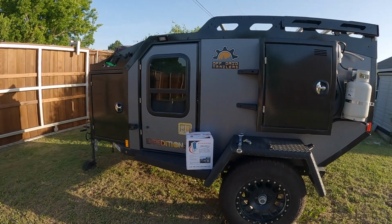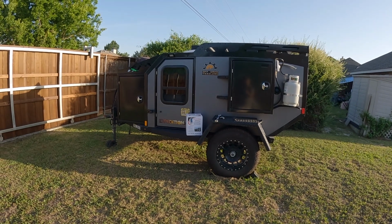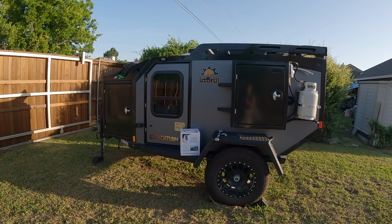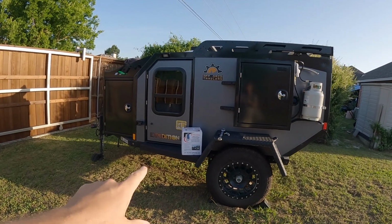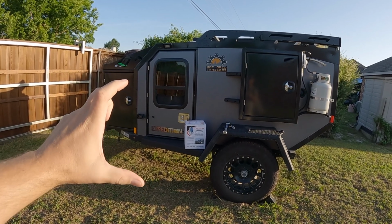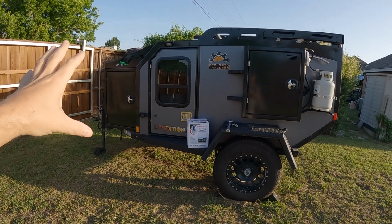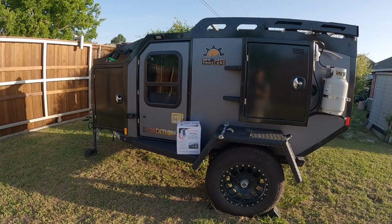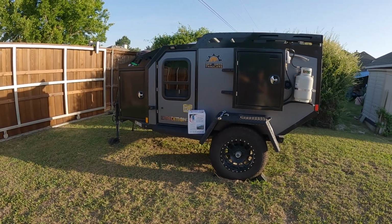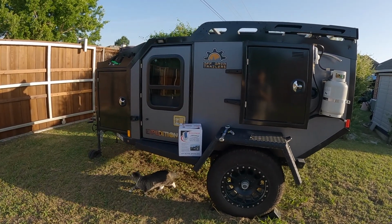Now, as far as installing these things, just to let you guys know, if you've got a custom shop that's willing to do it, awesome. I reached out to a couple of custom shops here in my area, and neither one of them wanted to commit to it. And the reason for that is to install these, specifically on a 4Runner, you have to cut about 4 inches off of the spring bumper that's inside the coil. And it's just a rubber bumper, but it is a permanent adjustment. Once you cut that, you're pretty much committed to putting these bags in and keeping the bags in. I'm pretty confident you can replace that bumper if you needed to, but it's not like replacing springs where you can just swap them back out for OEMs if you want to dump your 4Runner.